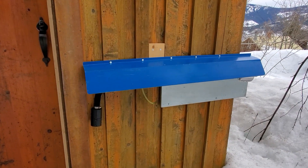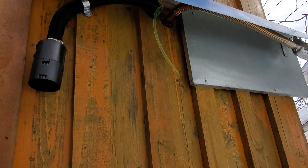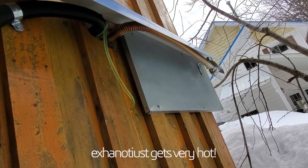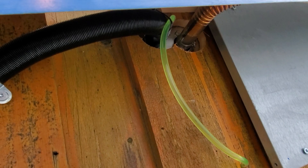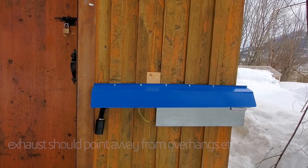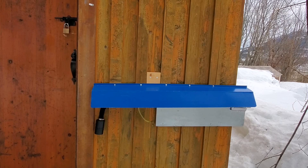Here I'm just showing the setup on the outside. They've got the combustion intake with the filter on it — that's what that black thing is — and there you've got the exhaust. I've put a heat shield there to protect the wood siding from the radiant heat coming from the exhaust, and the fuel line also feeds into the heater through there from inside the tank. I also installed a cover for the heater to stop corrosion and to stop water from dripping down the siding when it's raining and getting into the holes I drilled for the exhaust and intake. You don't really need it, but I feel like for the long term it might help, and it makes the whole installation look a little bit cleaner as well.